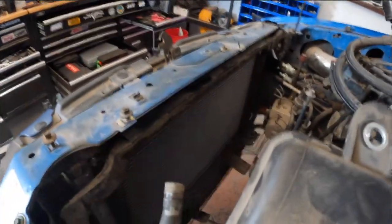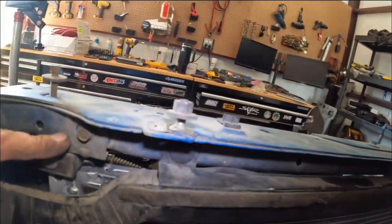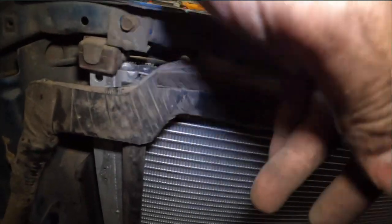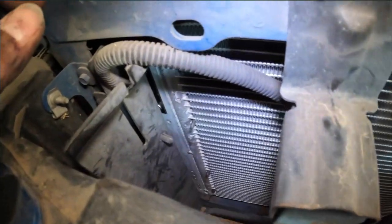All right, so the new condenser is in. A couple things. This wiring harness was definitely in the way. Just got these little tabs here, these little tabs right there. It's got 3 of them, so you have to take those out, and then you can pull these out. And make sure you get that little 8mm nut out of there. And then also it has this little plastic piece. I guess it's just so the airflow can direct back into the radiator smoothly. It was just a couple little clips, so you can actually see them on this back side. These little clips right here, they just kind of squeeze in and pull out, and so you can pull the whole thing out. Then you put it on the new condenser and call it a day.